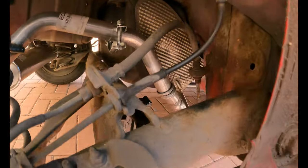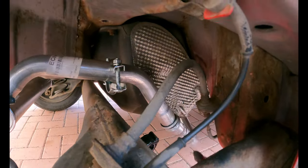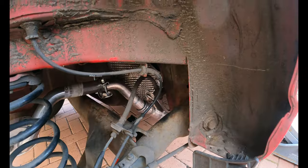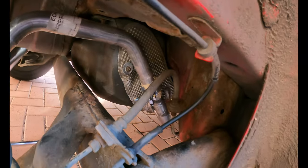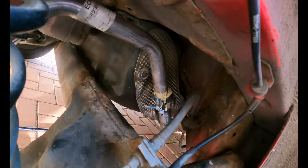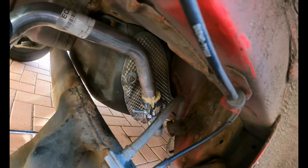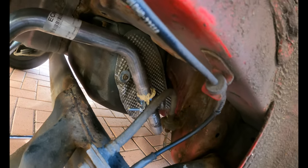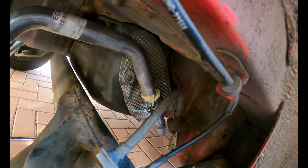And now while I've got it in this state, it's actually a lot easier to move. So let's get that caked up in some exhaust paste and bolted up. Exhaust clamp is now on, and the reason it's delayed is because I bought a different exhaust clamp. The one that came with it was just too narrow, so I bought a bigger clamp. That has really got it tight.